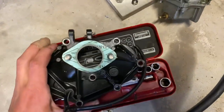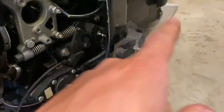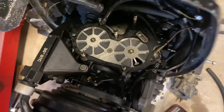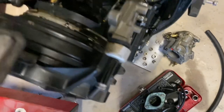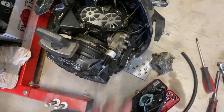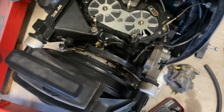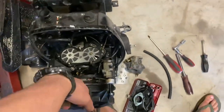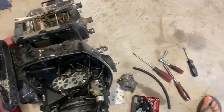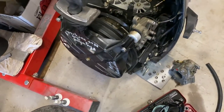So here's the bit we're after — this is the intake manifold. To show you why this motor is my parts motor: other than the bad leg, this one has swallowed a reed, which is not ideal. That would signify that fuel has most likely been spitting back up through the carburetor. I hope the reed has either gone out the exhaust or is stuck somewhere out of harm's way. If it's been chopped up I don't want to see what the inside looks like. But honestly, it pulls over all right and has lots of compression — the motor actually feels very sound and tight when you turn it over.